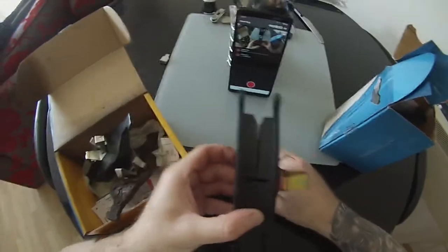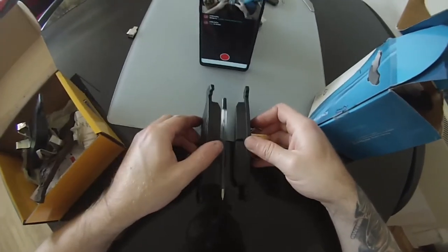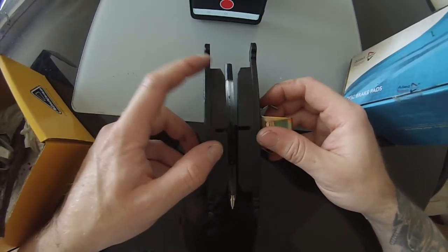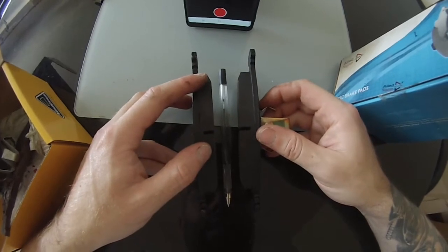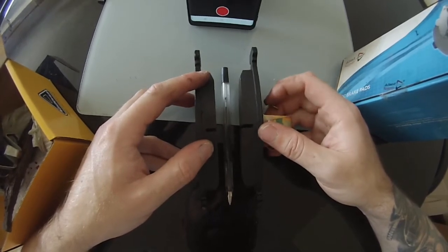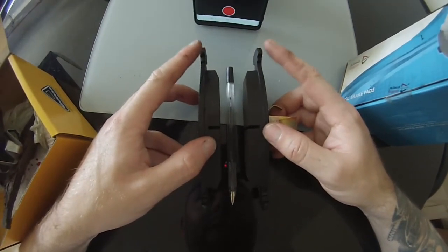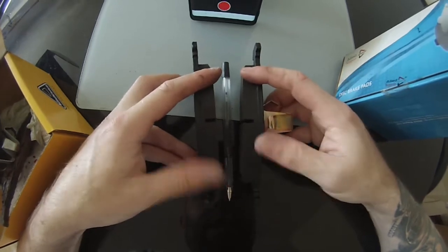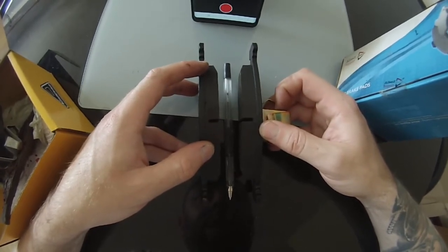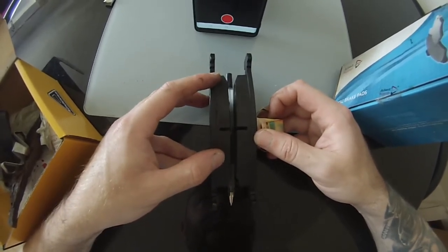And we'll act the pen as the disc. So it would be about there, I would say. But we're going to exaggerate the movement, okay? So you would put the pedal on, the brake fluid would build up pressure behind the piston, which is this side, if it's a one piston caliper. And the caliper joins the two pads on these connectors there and there. It's locked in a caliper, and this side goes with the pressure, and the caliper will bring this one in too, okay, and then bind and stop your car.